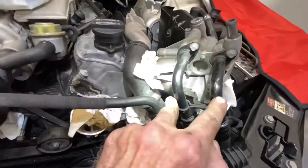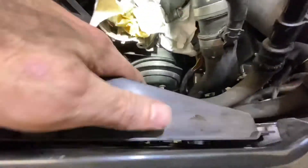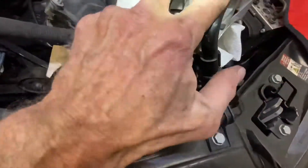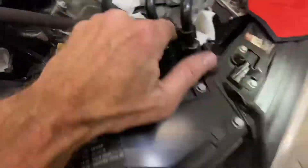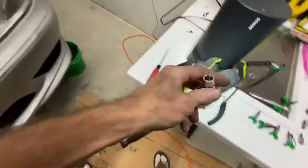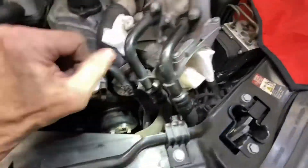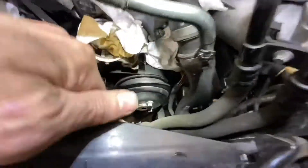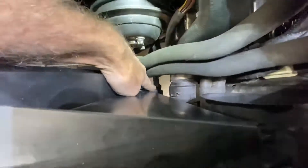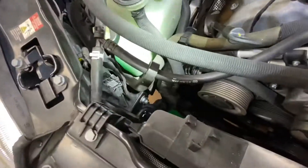These two hoses come from the oil filter, so I assume they're oil hoses, and they must go to a cooler. In order to get these hoses out of the way — they're flexible — I need to disconnect these two here and this one, and it will be an E10. So we'll disconnect the oil filter housing, get it out of the way, and then see if I can bend these hoses enough to get them clear of this connector and that little rubber thing, so I can get this out and give it some room to come out in this direction.